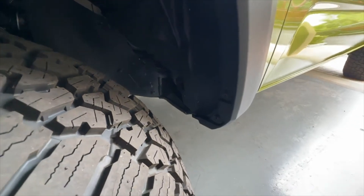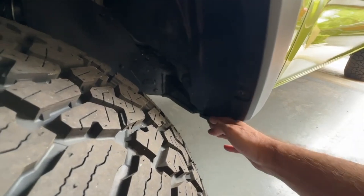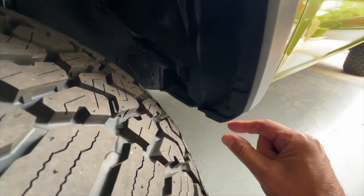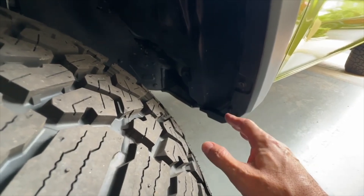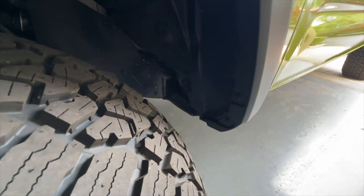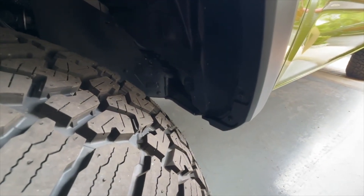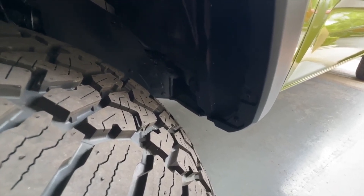The other issue was in the back — even with these tires, because of the offset, I had to remove the mud flap that was here. It was very, very close and there's no doubt in my mind that in the right circumstances it would have caught that mud flap. That's something else you kind of have to get rid of if you're going to run a negative offset.